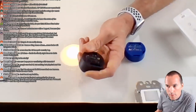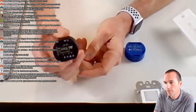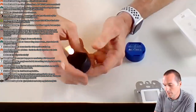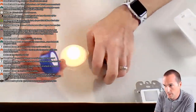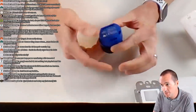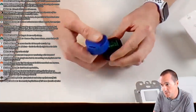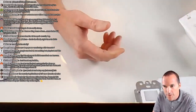Can you keep power monitoring with Tasmota? Yeah, all the Tasmota stuff is functional on here. You just flash it, and then you get power monitoring. You get relays. Everything works perfect, and it doesn't void your warranty. The Shelly guys will still warranty your stuff even if you put Tasmota on it. In fact, they're totally open to it. Love them. Love those guys.